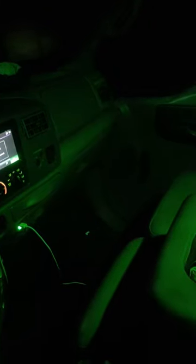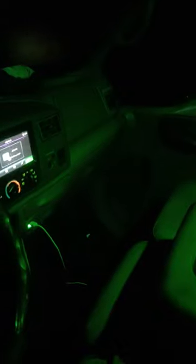I know a lot of people use self-tappers in the doors — they'll screw a hole in the door. I actually didn't do that. What I ended up doing, there's a bolt that holds the frame for the window. I don't know if it would be called a regulator because there's not a motor in this one — as you can see, it's a manual. But there's a bolt that holds it inside the door, and all I did was stick the ground wire behind that. When I have that door over there torn apart tomorrow, I'm going to show what I'm talking about. But anyway, thanks for watching guys. Later.